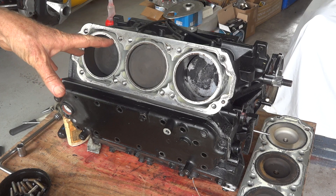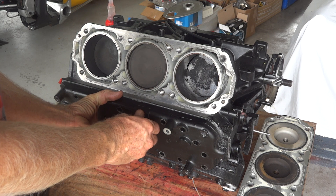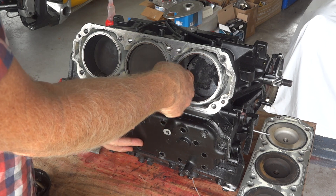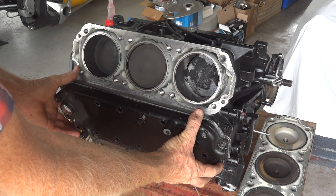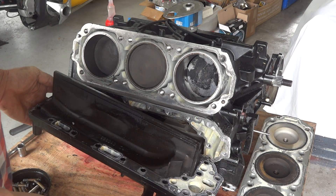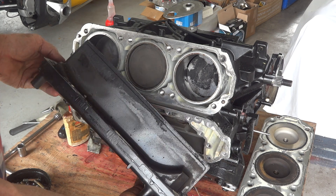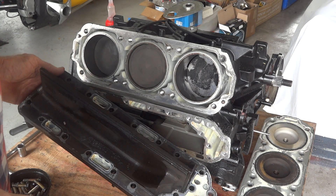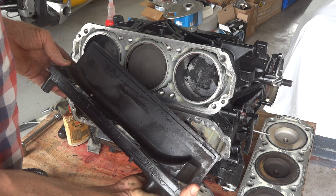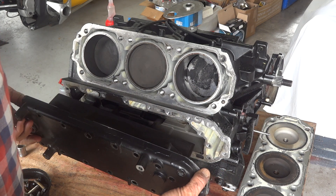While we've got this torn apart, one more thing. This is called an exhaust manifold in outboard world. The exhaust port blows into the V and blows onto this poor old thing and out the back. To avoid putting too much heat in the system, it's water cooled. I'm going to get that bit ceramic coated to keep some heat out of the system - gives the whole thing a better chance.